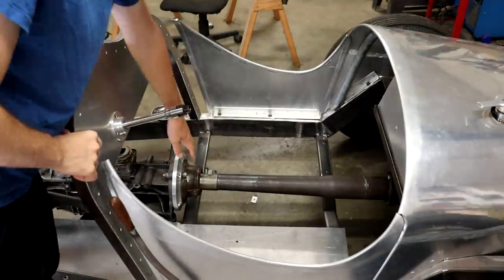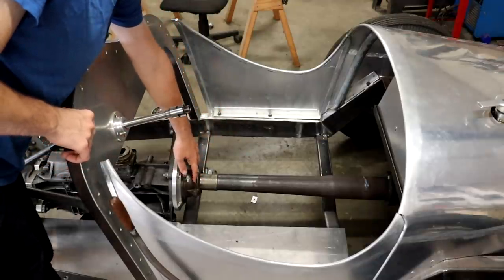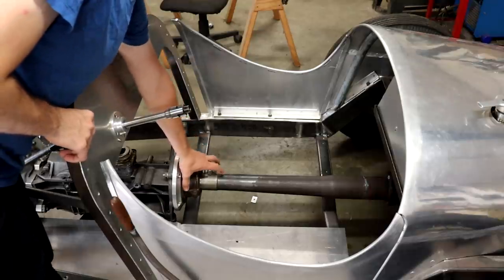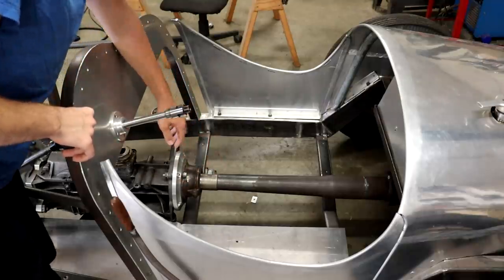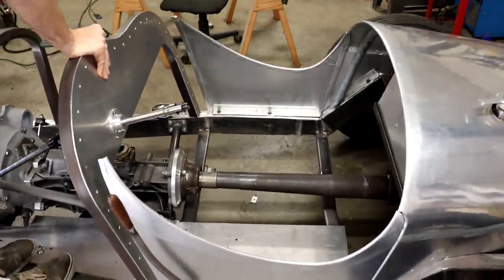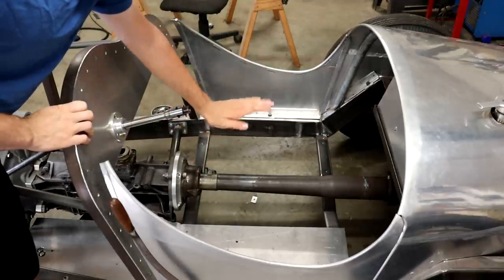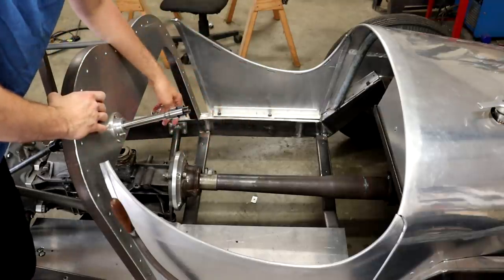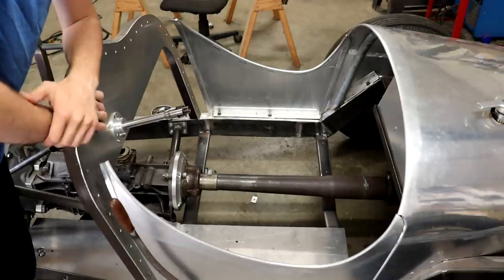So as you can see here now, I've got the torque tube assembly and driveshaft all assembled in there. When I was assembling this upper clamp I put a little bit of oil in there just to stop it from rusting for now. But when this is all finished, this whole assembly up here with that U-joint will be packed full with grease to make sure it is nice and well lubricated. I think it looks really good - you can see how it works with the U-joint centered in this ball joint, and that's where the rear end pivots from. This is really one of the final steps of the drivetrain - it's now just getting the engine back, which hopefully I'll be getting fairly soon. Thanks for watching and I'll see you next time.